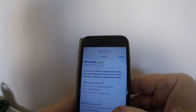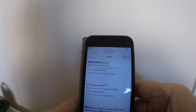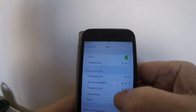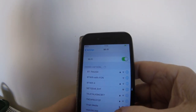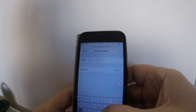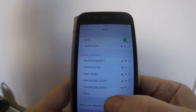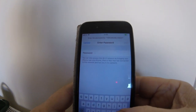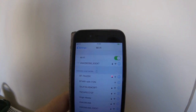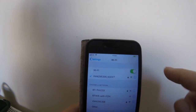It says to connect any Wi-Fi device like you would to the main network, then click continue. Now it's setting up the connection. I select the 5 GHz network and enter the password, then join that network. As you can see, there is now a blue tick on it, so we'll come out of that page.